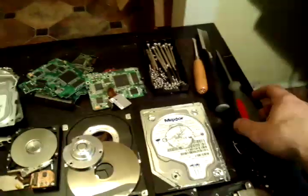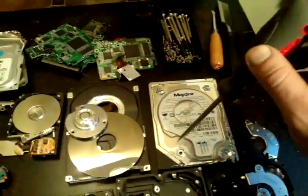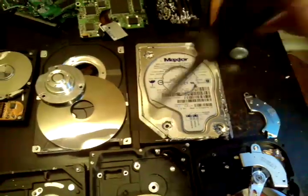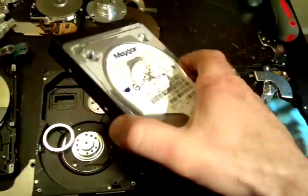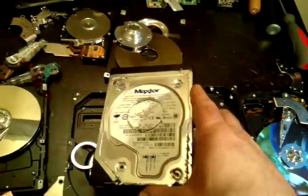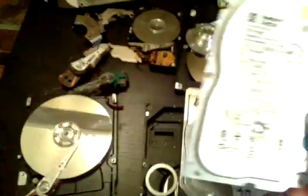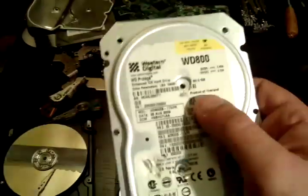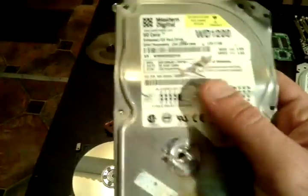Let's describe the tools you'll need. You've got here a Torx screwdriver — in order to remove the actual screws you're going to need to use this. Don't try to hammer this open because you're not going to do it. Those Torx screws are a lot stronger than regular screws because of their cool design. Also, you're going to have to find these little hidden holes and scratch the label off, otherwise you're not going to find the screw hole points. Each hard drive is different — you'll have to hunt down where those little holes are.